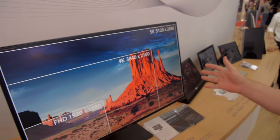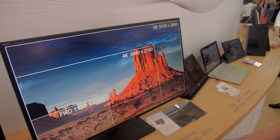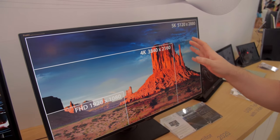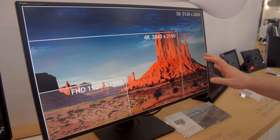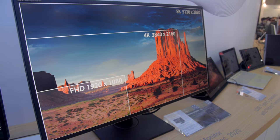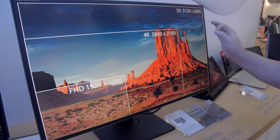I found a new thing that moved to the top of my evil lair wish list, and that's this 32-inch 5K Ultra HD monitor. This is 99.5% Adobe RGB and 84% the REC 2020 standard — yes, 5K, 5120 by 2880. This does require DisplayPort 1.3 for full functionality, so this is super bleeding edge. This is the Asus ProArt 5K 32-inch UHD professional monitor — the absolute top end in professional graphics right now.